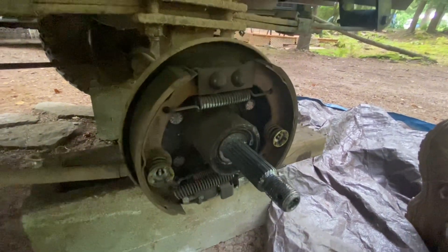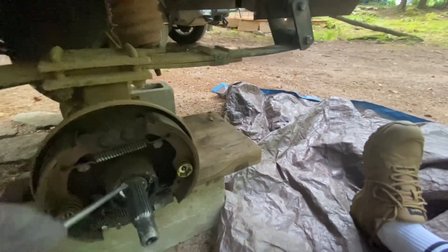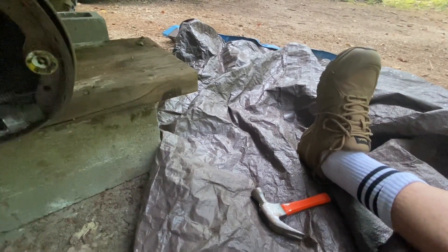This side was the one actually causing the problem — it was worn down. I'm noticing that inside these little grooves, there are pieces of metal stuck in there, so I'm taking a screwdriver just to clean them off before I put the drum back on. It would not fit otherwise. So I'm going around and cleaning each one — you can see a whole bunch of metal coming out, which is probably pieces of the old drum.